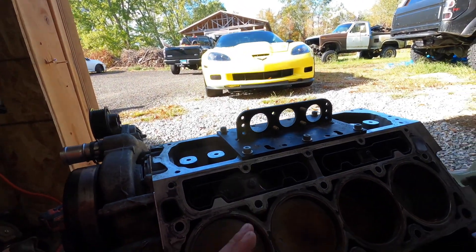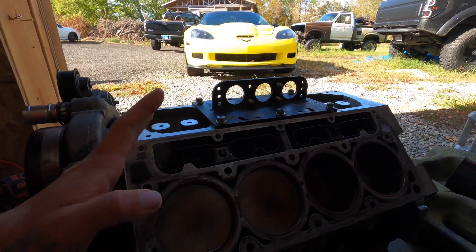So when we get this rebuilt with new pistons, they're going to have stronger tops to them and they're going to be gapped for boost, so this doesn't happen again. Because when this did happen, I was driving around for a couple hours and beating the hell out of it, so I know I was way over-abusing the motor for what we had here. That's why we're going to rebuild it, take all the parts that we need out of here.